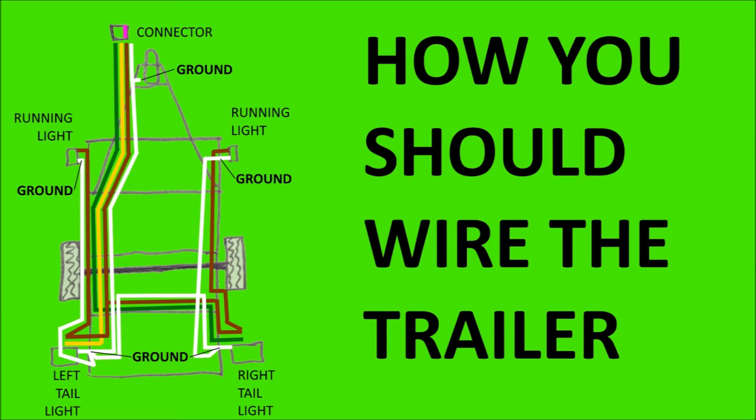So this is how I would wire the trailer if I had to do it again. I would bring all the wires down the one side of the trailer and then fish it across the back of the trailer to the other side. This would clean up the neck of the trailer so there would only be one wire coming down the trailer, and I wouldn't have it wyeing and going down the trailer in two separate paths. I think this would look a lot neater, and it would definitely make the ground connections a lot easier to do. It's the same amount of ground connections, but there's fewer wires going in each one, and I think it would just be a lot cleaner and easier.